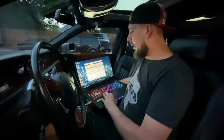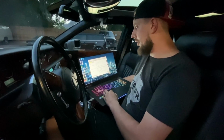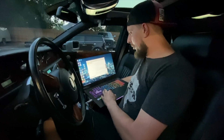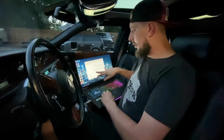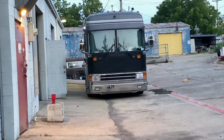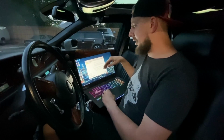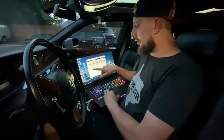These are the two big faults we're worried about. Where they came from, when they occurred. I actually can't technically even pull them all the way because I can't get a response back. It's telling me to check the bus signal, and I'll have to do an exploded view of the wiring diagram. The bus is fine, but I don't know what you're talking about. So I'm going to have to do a breakdown on the diagram and figure out exactly where it's saying that it's losing connectivity. So these are our two big issues here.